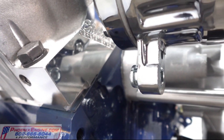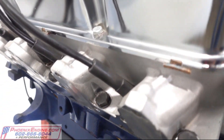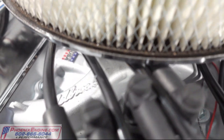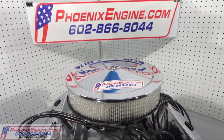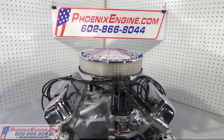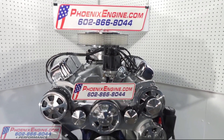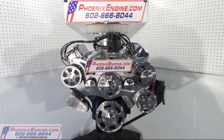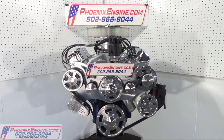The Fast Track was created by us approximately 15 to 16 years ago. The main reason for the Fast Track is we don't sell an engine unless we run it. Most companies will run it for a few minutes or 30 minutes breaking the cam, but we actually spend a full day on the engine. We want to go through the heat cycles, let the rings seat in, go through the carburetor settings, put a curve kit in the distributor, and if we do a Holley Sniper — which we recommend — we'll also do the super tuning. It's very reliable and also good on gas on all engines.